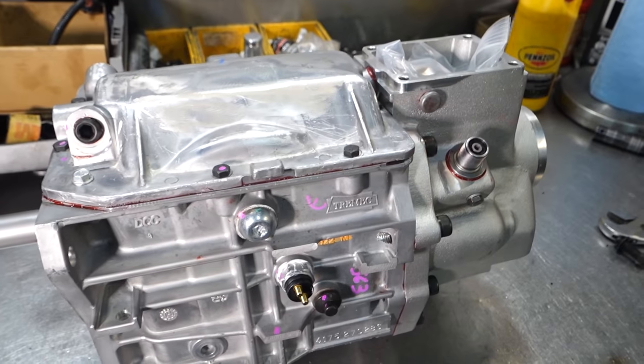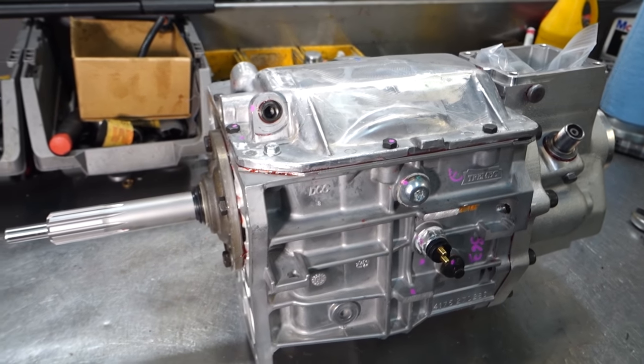The extension housing is a pretty critical component — everything has to line up exactly right within five thousandths of an inch, which is about the size of two human hairs put together. In order to do that, you have to have pretty intricate CNC equipment today with high-tech measuring so that you can get everything dialed in exactly where it needs to be. Otherwise the transmission is not going to turn, it's not going to shift properly, it's not going to have a good neutral gate, and the speedometer gears aren't going to line up. I hope this video gave you a little insight into how I go about designing transmission components and how to shorten the transmission so it fits into an XKE Jaguar. Thanks for watching.